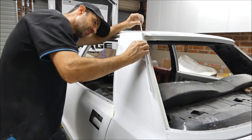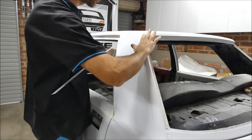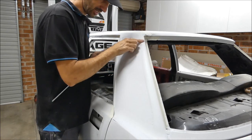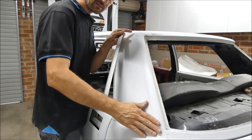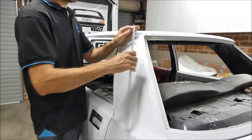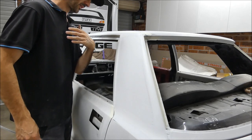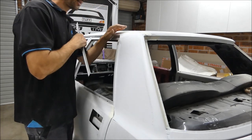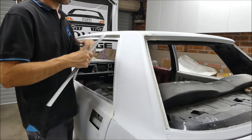In this case I want to make sure they're a hundred percent before anything goes on - the rubber sits absolutely flush without any tiny little gaps. If I put my straight edge here, that's showing me a gap from about there to there. You can actually feel it - it feels like a dent, but it's actually that this area is high and it hasn't met gradually - it sort of met a little bit sharp there. They've left the raw metal, they don't even care. That C-pillar molding that was here would have hit a lot of that as well. They're all tiny little defects from back in the day - the designer wouldn't have designed the car with those defects, but the manufacturing process hasn't allowed the tolerances to be absolutely perfect. I'm trying my best to fix those as I go along.